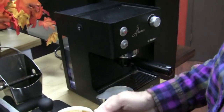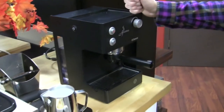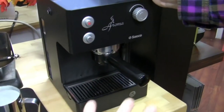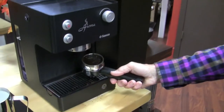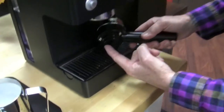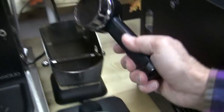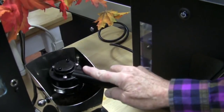That is the Saeco Aroma — a little workhorse of a machine. Not a lot can go wrong with it. We've had people have these for quite a long time — some for 20 years. It requires regular descaling, keeping everything clean, doing a tune-up, and replacing gaskets and O-rings every so often. You can also run Cafiza through the portafilter to clean the pressurized valve — just a quarter teaspoon in the basket, brew until you see suds, stop, let it sit, then keep running it until it looks clean.